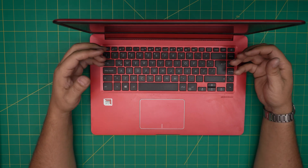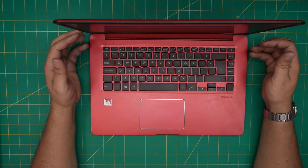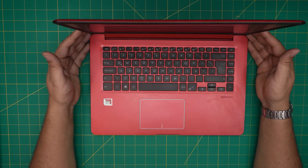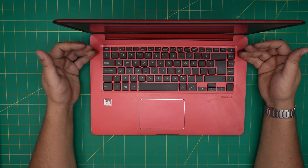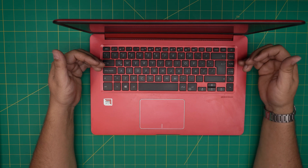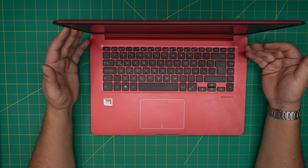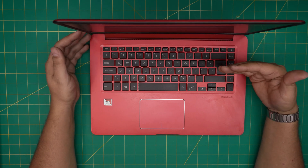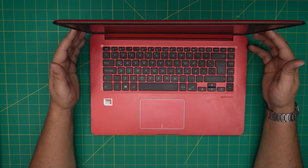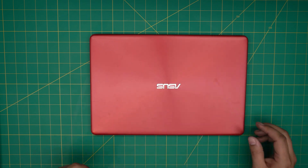In this video I'm going to go over how you can open it up and how you can remove or replace the RAM with no issue. By removing the RAM you're not going to modify the system — you don't have to do any configuration or anything like that. These laptops have a basic locked BIOS, so if you put in a high-speed RAM, the BIOS will actually downgrade or underclock it to its own specific speed.